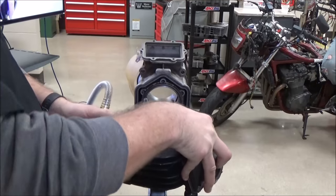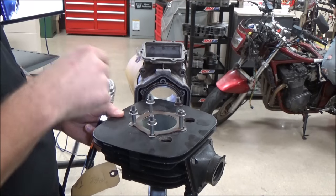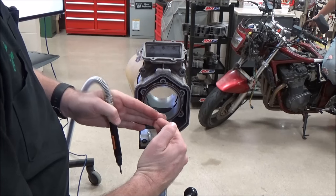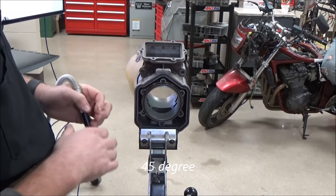When we run this through a boring bar, it creates a really sharp edge across all those ports. What we're creating instead of a 90-degree edge is a soft lead-in so that the piston ring can come in and out of that area with the least amount of effort.